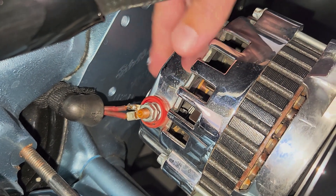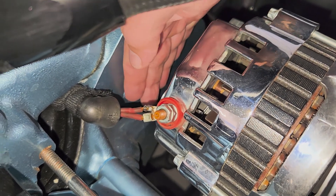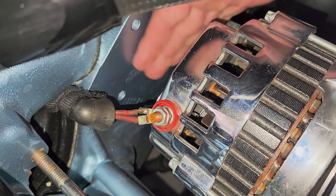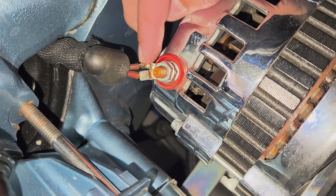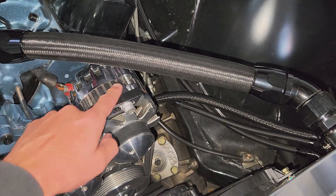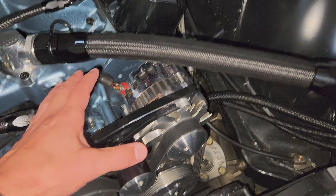I have a Painless Performance wiring kit and there are two wires coming off of it, and I can kind of tell it's a little dark and black — I don't know if that's staining from the boot that was on here, but that's suspicious. That alternator is actually pretty warm, and I was dead cold just seconds ago. I'm going to Google that. After Googling the hot alternator issue, it turns out that if your alternator is hot like that it might not be grounded properly. So let's check this out. The premise of a one wire alternator is that it needs a ground path. This is grounded on a bracket that I painted; the engine's painted. I have all kinds of paint, so I'm leaning towards it — this is not grounded.